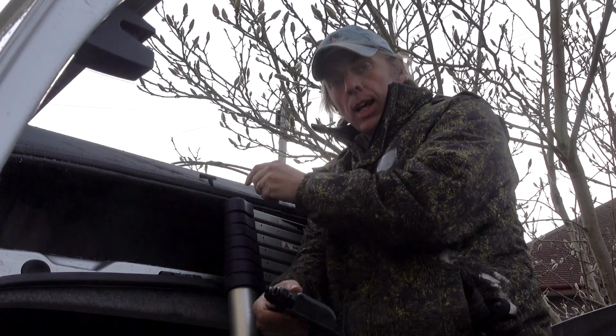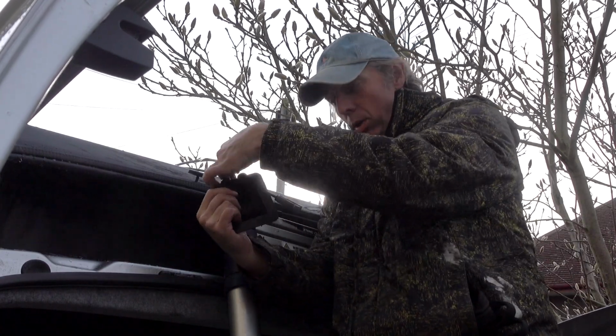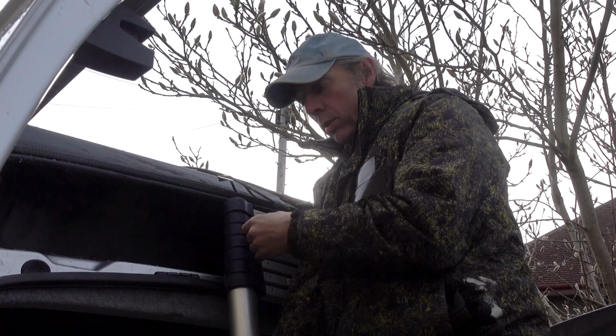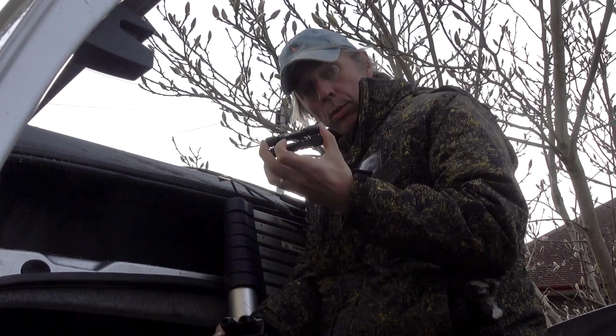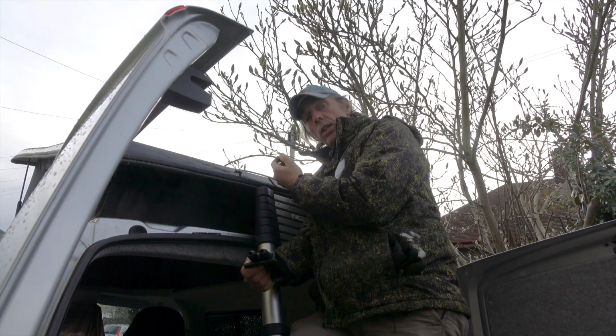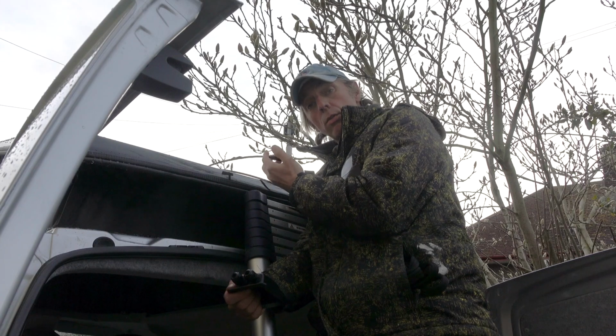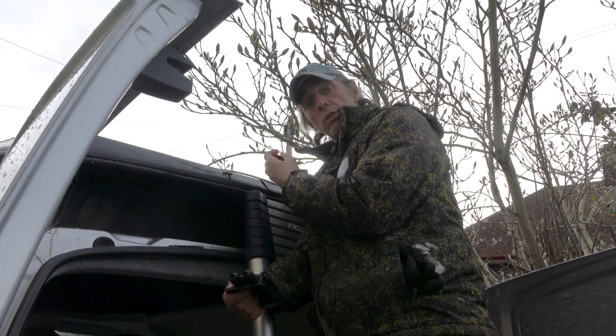Now we've got to thread these cables through this entry box. And as you can see, they're not going to go with the plugs on. So we need to cut the plugs off, thread it through, and then put some new plugs on, because you can't reuse these once you've taken them off. Now just remember, when you cut these cables, the solar panel's live, it's always producing current. So do one at a time, and that will reduce the risk of a short circuit.